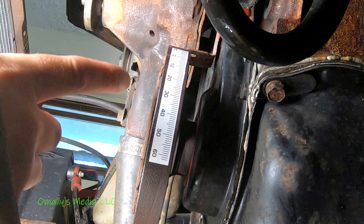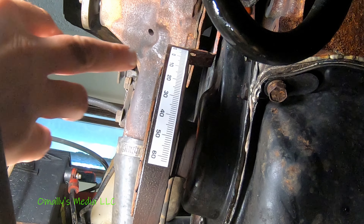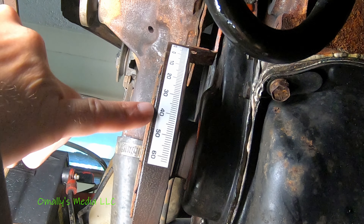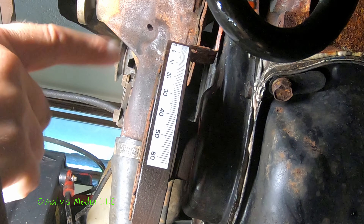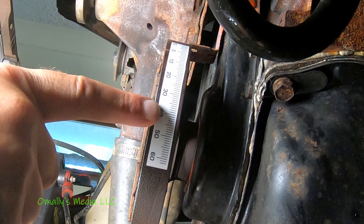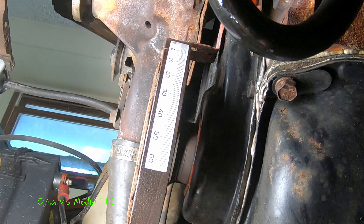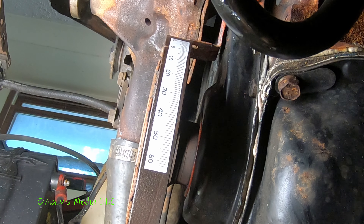If you're into racing and you're running some type of total timing — let's say you're running 15 on the front side with 36 or 37 total — as you bring the RPMs up you'll see it come back into the upper 30s, between 35 and 40, and you'll be able to more accurately set your timing.